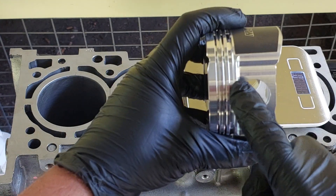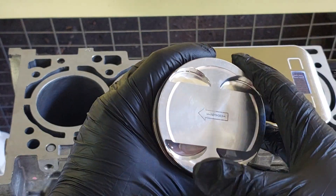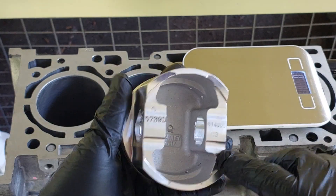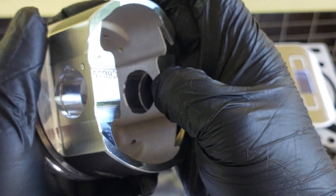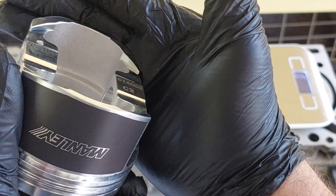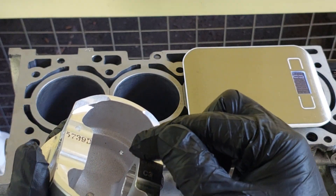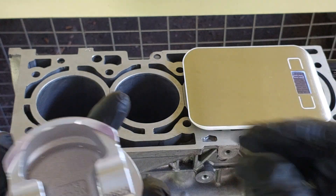So we're basically going to look at the piston — this area here is going to be the skirt, pushing and pulling. You don't really want to mess with that. This is your compression surface, you don't want to mess with that either. So there's not really much area here where you can work on. What you can do is add a little chamfer on this edge — if you look very closely you can see there's almost like a little chamfer on there, a 45-degree angle. You can run a rotary tool across that line there, and on the other side run across that line there as well, increasing the size of the chamfer.